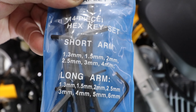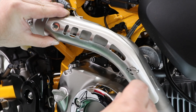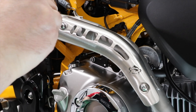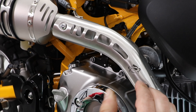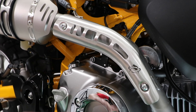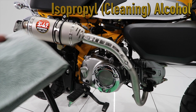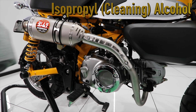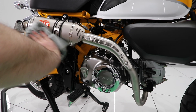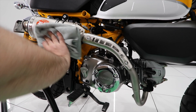The final step is to mount the exhaust pipe heat shield, for which you'll need a 3mm hex Allen key — and once again you can fully tighten the two screws down. Just before you fire up the engine, it's a good idea to give the full exhaust a wipe down with some cleaning alcohol so that any fingerprints don't get permanently etched into the finish once it fully heats up.